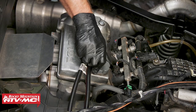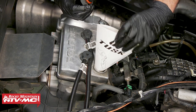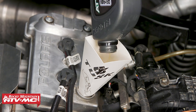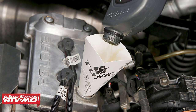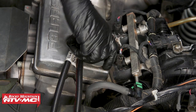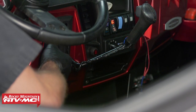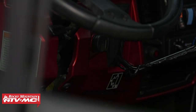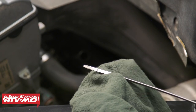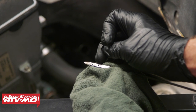Back at the top of the engine, we'll remove the oil fill cap and install the paper funnel that came with our oil change kit, and we'll pour in 2.4 liters of oil. Always use the spec that's given in your model-specific service manual. Now we can remove the funnel and reinstall the oil fill cap. With the cap in place, we're gonna run our machine in a well-ventilated area for a minute, shut it off, let the engine cool for a minute, make sure we're on a level surface, and then we can check the oil level on the dipstick and make any adjustments that are necessary. When you check the oil, just make sure the level is between these two dots.